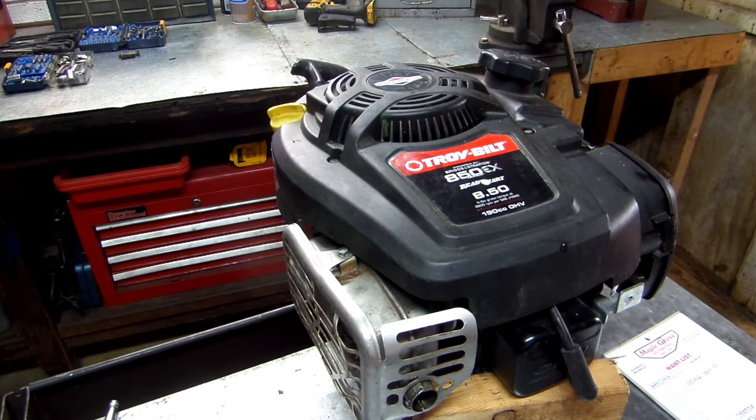If you're cranking it up and it sounds like it's just flooding out and not running right and blowing smoke, your thermostat could be an issue. It could be hung, stuck holding the choke closed and just feeding your motor gas through your choke circuit. So it being hung either way can cause different issues. Especially if you have a new carburetor on there and you know you have spark and you have clean gas with no water in it and it's just not firing at all. And if you spray ether in and it fires up and stays running perfectly, then the thermostat's hung wide open, just letting air through, and it's not allowing it to close and start pulling gas from your choke circuit on the carburetor. So I hope that helped.